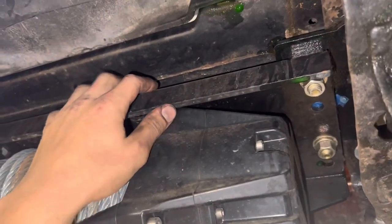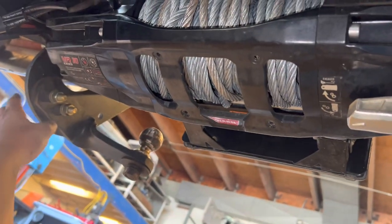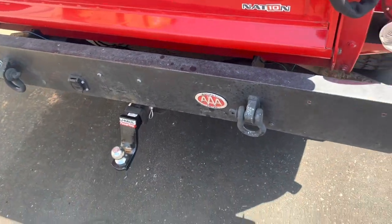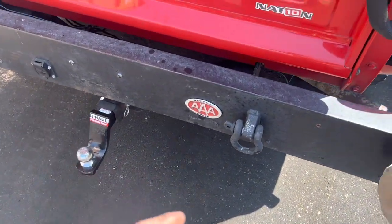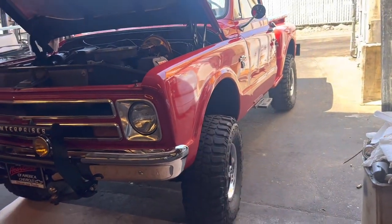I have this engineered vintage cross member up here for my winch. Between this and my rear bumper being a piece of C-channel, and my truck having skid plates, extra gear, and the push bar bolting the two frame rails together, this has to be a very stiff frame — probably about as stiff as you can get them. I've been considering on the back of this truck, a lot of the lowrider companies for the lower C10s make a rear cross member — an extra one that goes back in there. If I can fit one in, I might put one in, because there is a little bit of flex in the back. I really like the idea of the frame not flexing. The suspension should flex, not the frame — there's no reason for your bed to hit the back of the cab because your frame flexes.